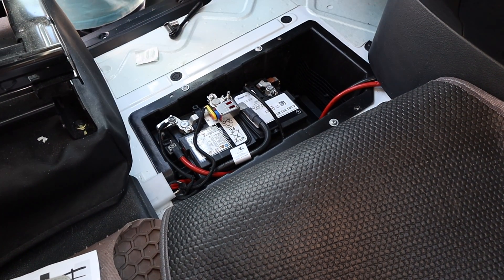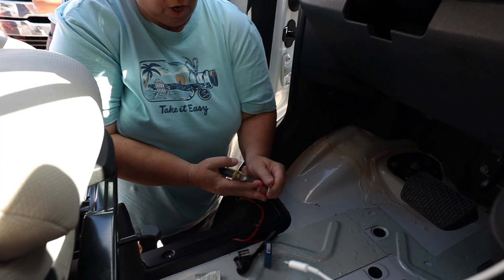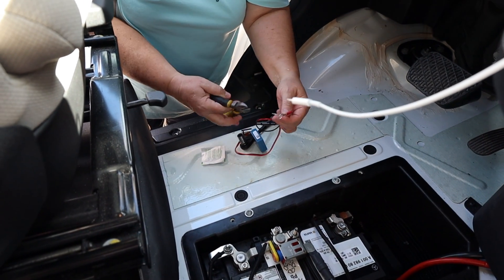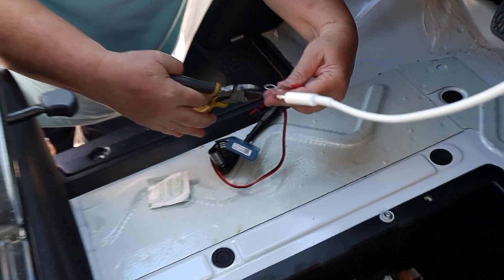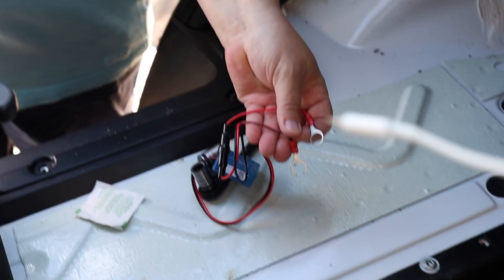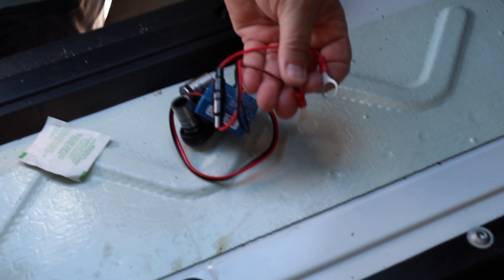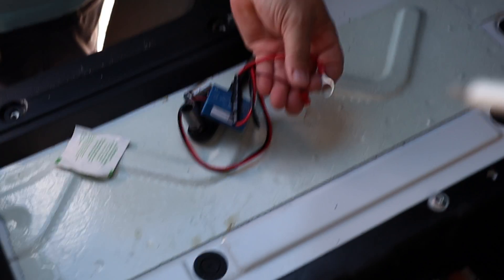The first thing you want to do is cut a small section out of the ring terminals using side cutters — basically wire cutters. That keeps you from having to completely remove the nuts, because otherwise you reset all your controls on the dash. It's more about safety — you're working on positive terminals and you don't want to short anything out. If you can just loosen the nut and slide something under, that's the safest approach.